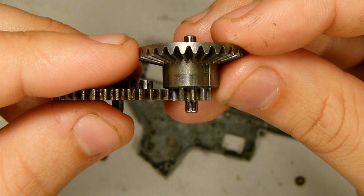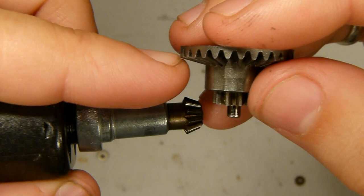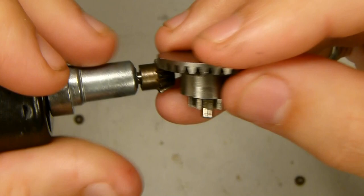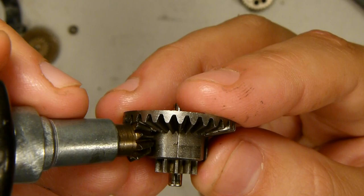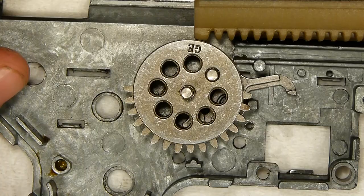The other thing you want to do is make sure that the contact between the pinion gear on the motor and the top teeth of the bevel gear is ideal — meaning maximum surface area contact with the teeth. If they're barely touching, just the tops of the teeth are touching, you're going to strip something out a lot sooner rather than if they're flush and can grab the entire surface of the tooth. But we also don't want the bevel gear shimmed so low that it's pushing down on the axle and causing extra friction and extra wear.